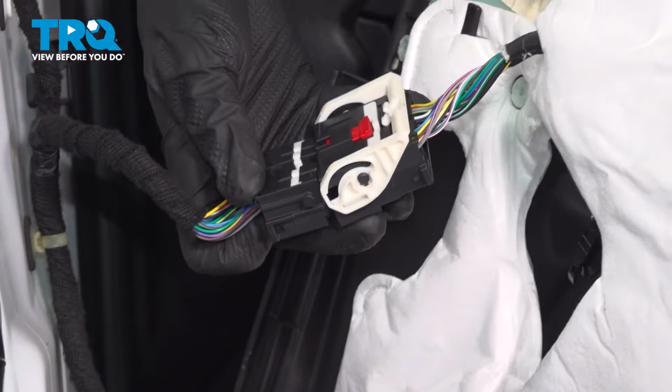Continuing from here, we're going to bring it a little closer, and it's time for our inside door handle cable. To install the cable, we'll take the far end, slide it right down into that handle. Now we're going to carefully tug on this. That gives us some slack. We'll bring it through this groove and then lock it in right along here. Get it aligned, press it in, listen for a click, give it a wiggle and a tug. Make sure it's properly secured.